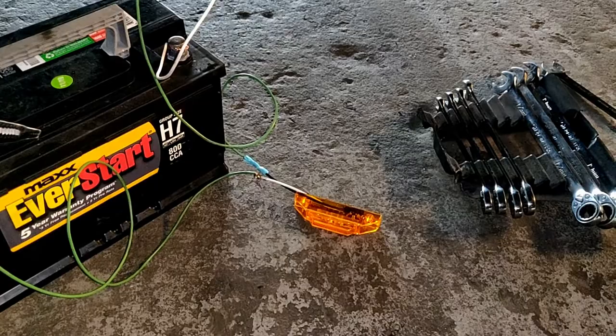It has a light that will show you the low pressure — when the pressure is lower than 70 psi, the light will come on. Keep in mind: here is the supply port and here is the delivery port. The supply port is where air comes from the air tank, and the delivery port goes through the axles to all eight tires.